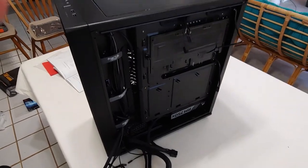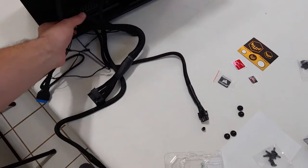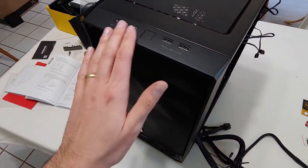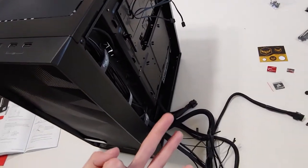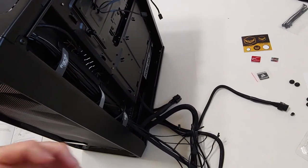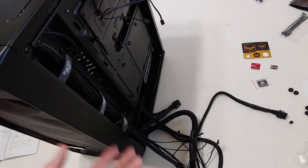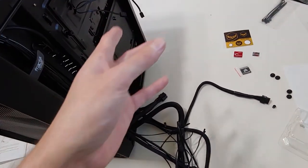All right, guys, so we've moved on to working on the cabling. This is from earlier. We have all the cables from the power supply. These are the cables from the front, the ones from up here: the USB, the audio, the power, the reset. I've realized I only have 3 fan headers, so this will not be ideal. Take this bit with a grain of salt. I'm gonna just plug in essentially half of my fans. I can plug 3 of them in. I'm gonna plug the 2 intakes and 1 exhaust for now.